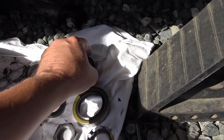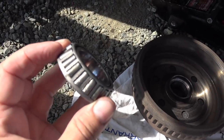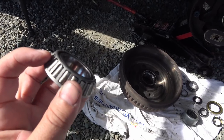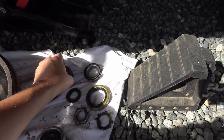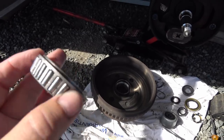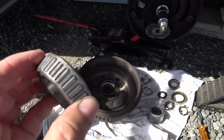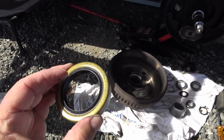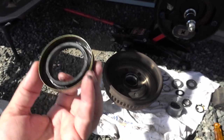I did find one that's not in the greatest shape. I don't know if you can see this, but some of the bearings are starting to get a little pitted, so I definitely think I'm going to want to replace all my bearings. That's the outer bearing — the inner bearing looks a lot better. They were done about a year and a half to two years ago at the dealer. My seal was fine and didn't blow any grease into the brake area, but they'll all get replaced.